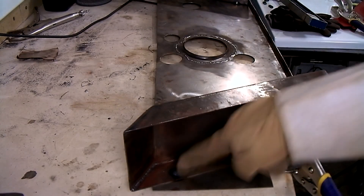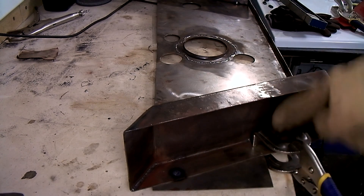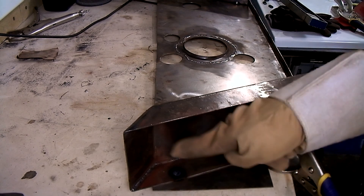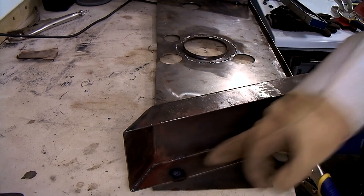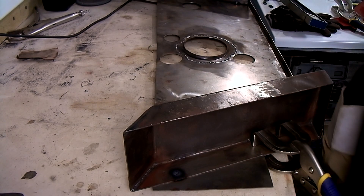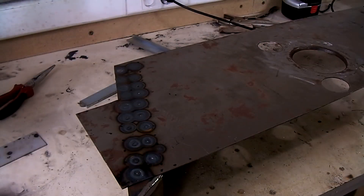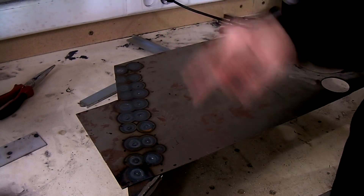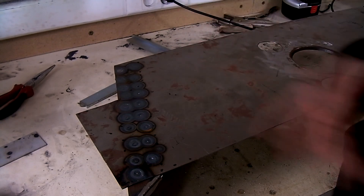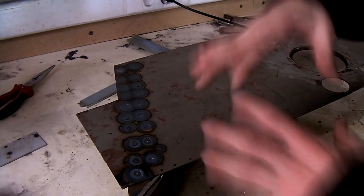As you can see, that's the part where it has penetrated — so that spot weld has worked. I'll try to do two side by side every inch or so, and that's the way it was originally done. These are 19 spot welds and everything worked like planned so I didn't have to drill any holes, and I'm quite sure that will be very sturdy. I counted on the original panel and the original one had 18 spot welds, so these are 19 — I'm happy with that. Now I'll do the other side and continue adding panels until we have a complete front T-section.